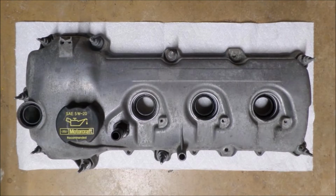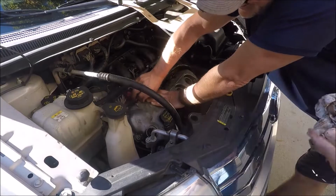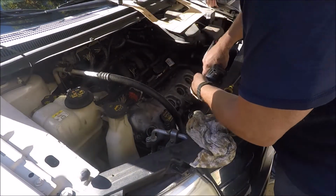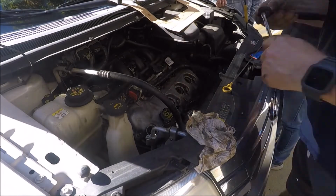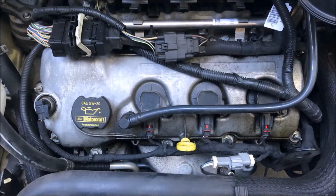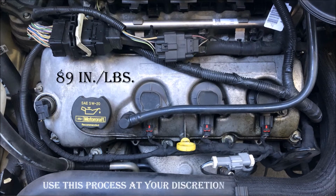Installing the cam cover, it's important to follow a specific torque sequence. I could not find a suitable source for the exact information online, but after years of doing these, I did the following. I initially installed all the cam cover bolts finger tight. You'll see I lightly ran them in with a drill driver and then tightened them a little further with a 1/4-inch ratchet. Finally, I used a torque wrench to apply 89 inch pounds of torque to each cam cover bolt